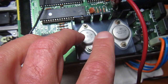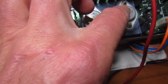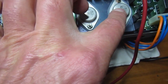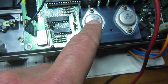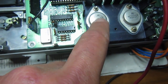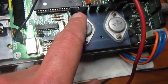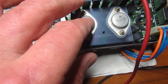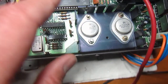Keep in mind that the difference between 13 volts and 5 volts is dissipated in heat on this regulator, and also the difference between about 20 volts and 12 volts is dissipated here. They are very close. This gets very hot during the work of this drive. So let's see the difference when I move the blue wire.